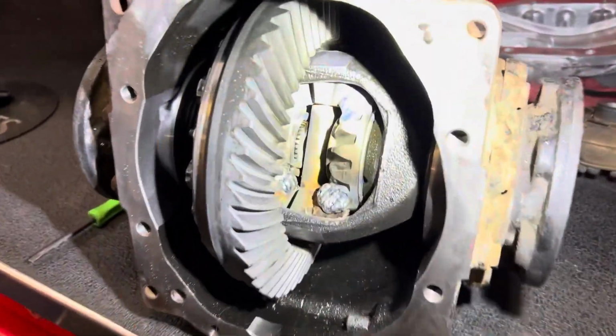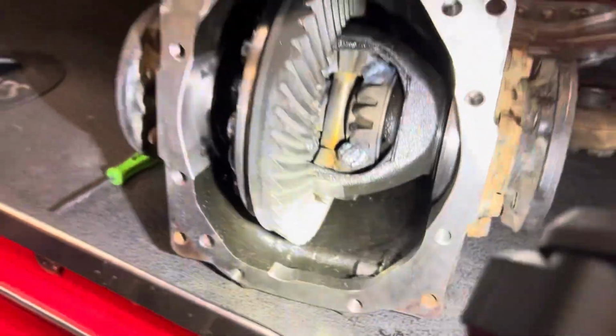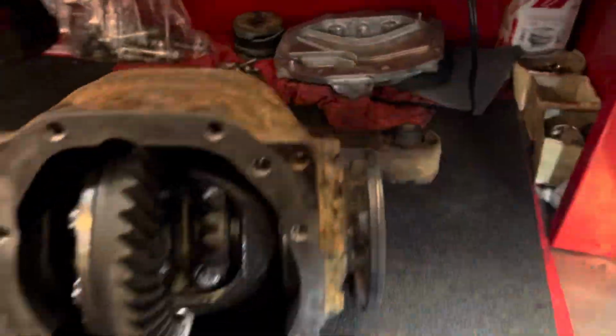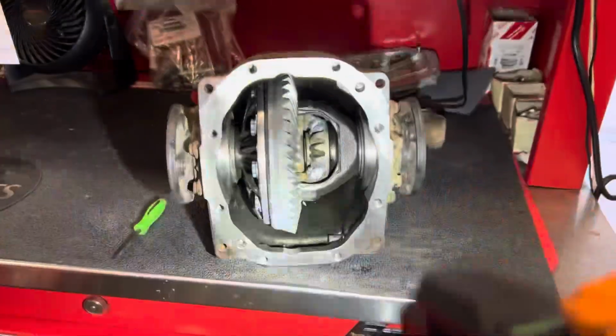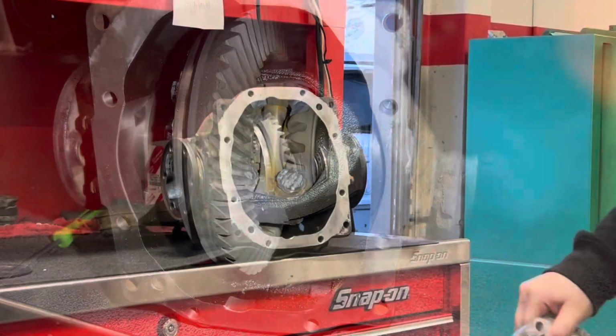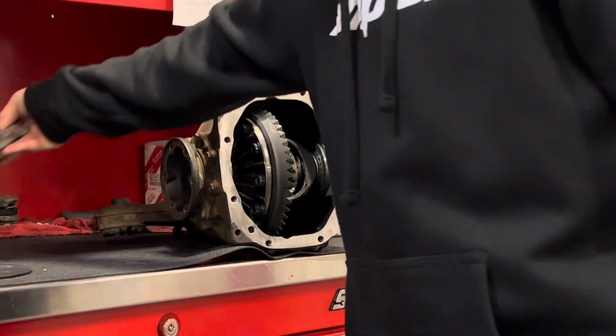So now I'm gonna blow it out with some air, make sure all the extra stuff's out, like little blue gaskets and stuff like that down there, and then I will get ready to put some orange Toyota FIPG on there and reseal it, bolt her down and torque it to spec, and then it should be ready to go in the car. Just make sure there's no dust on it.